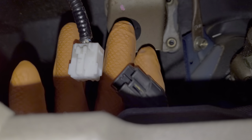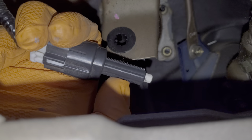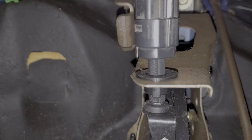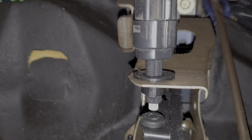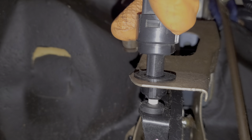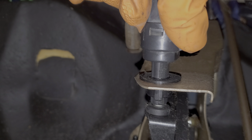To install your new switch, simply click it in position, and when you click your new switch in, your brake light should immediately come on. You'll notice there are some notches on your switch — that is for adjustability. You can push the brake light switch in all the way and then lock it in position, which means the lever will have to come out a ways before that switch is activated. You can also install it not enough, and that might make the brake lights always on or go on and off as vibration occurs when you drive. So you want to fine-tune and find a good adjustment place for the brake light switch, and then lock it down.